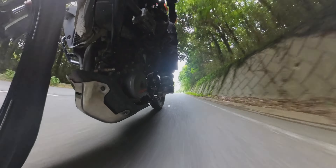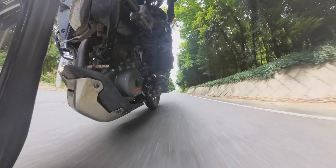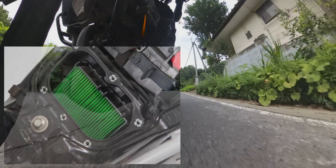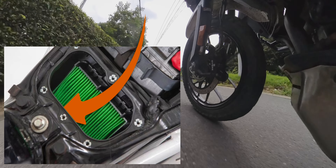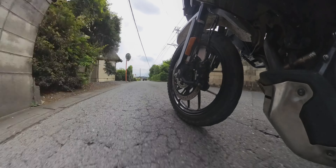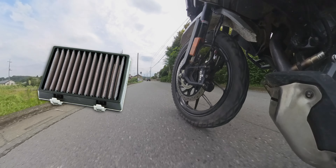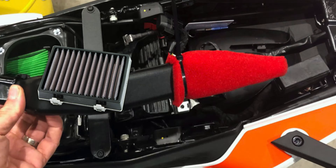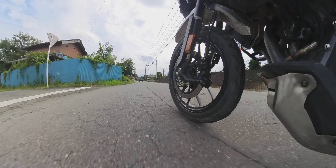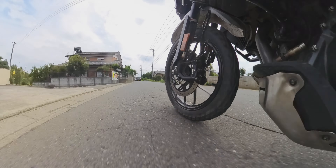However, there are a few downsides to consider with this upgrade. Any aftermarket airbox lid filter will bypass the main intake filter, meaning that you may not be getting the highest quality air into the engine. So if you live in a dusty area, I cannot recommend this upgrade. I would recommend an aftermarket filter inside the airbox with a pre-filter on the snorkel instead. If you're interested, check out the video link above for more information about this upgrade.